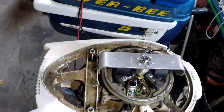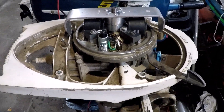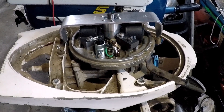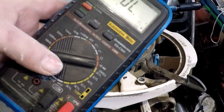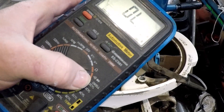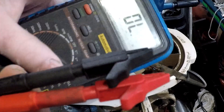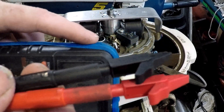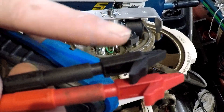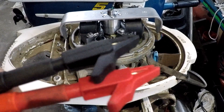Here I've got my automotive multimeter set to continuity. I found it's easier with a set of leads where I can change out the ends — from probes to regular points or two sets of alligator clips — so I can clip onto here. First we'll test for continuity between the leads and we're good.